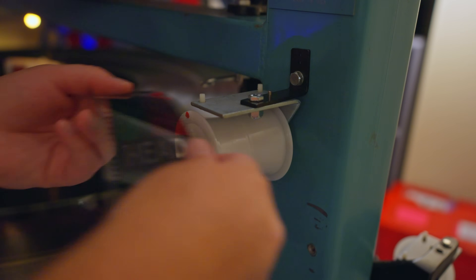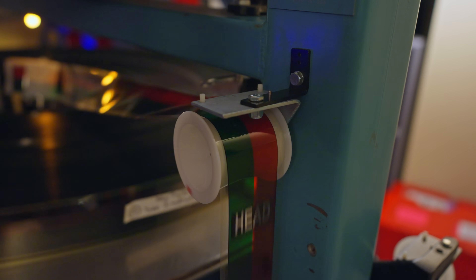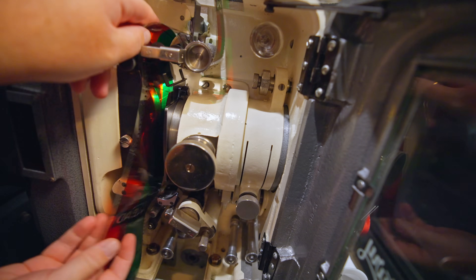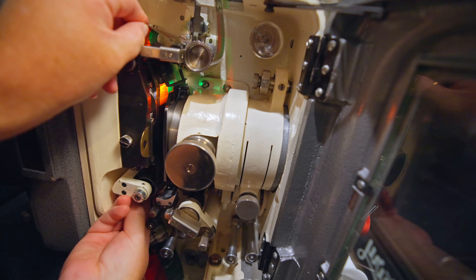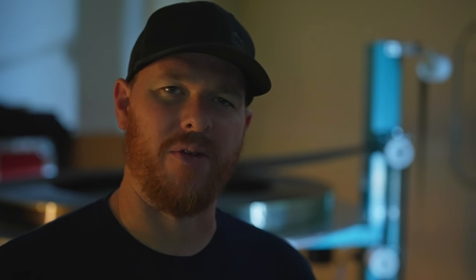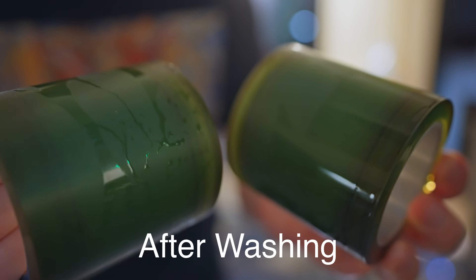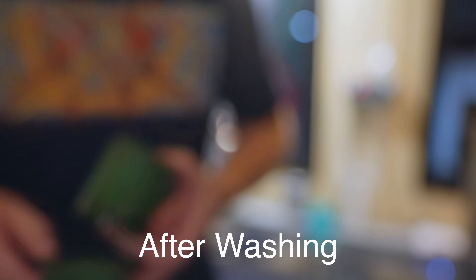The other thing people were commenting on was why don't I wear gloves when I'm threading up the projector and handling the film? There are a couple reasons. One, it's not needed, because the oils from my hands don't really matter if I'm getting that on the threading leader, which is what I'm dealing with primarily. It's a part of the film that no one sees — I use it just to thread the system and it never appears on screen. I also clean the projector after every show, and there are tacky rollers that take off particles of dirt and dust off the print while it runs.